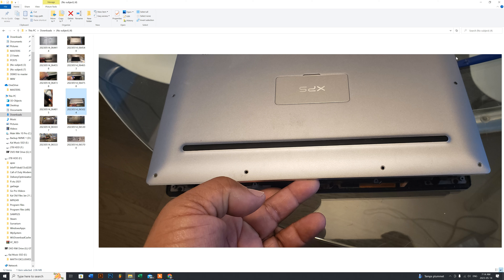Once I released all the corners, I found the top right corner still wouldn't open. I tried grabbing it from both the left and right-hand side, turned it slightly, and pulled up from that corner — then the whole part released more easily. Sometimes it's not always easiest to open from the top front or front middle; sometimes you have to turn it sideways, put your left hand here and right hand there, and lift it up from the side. There are no cables attached to this bottom panel, so don't worry about pulling anything apart — it's just the aluminum panel.